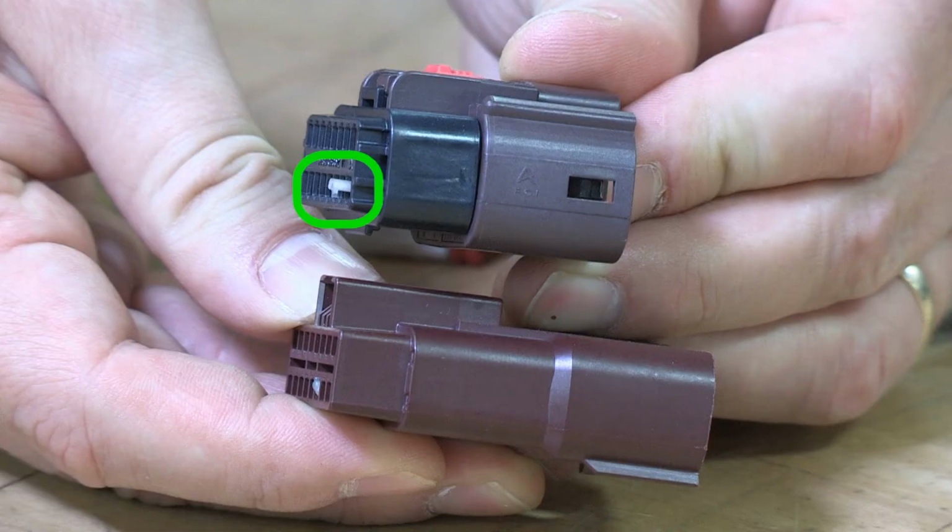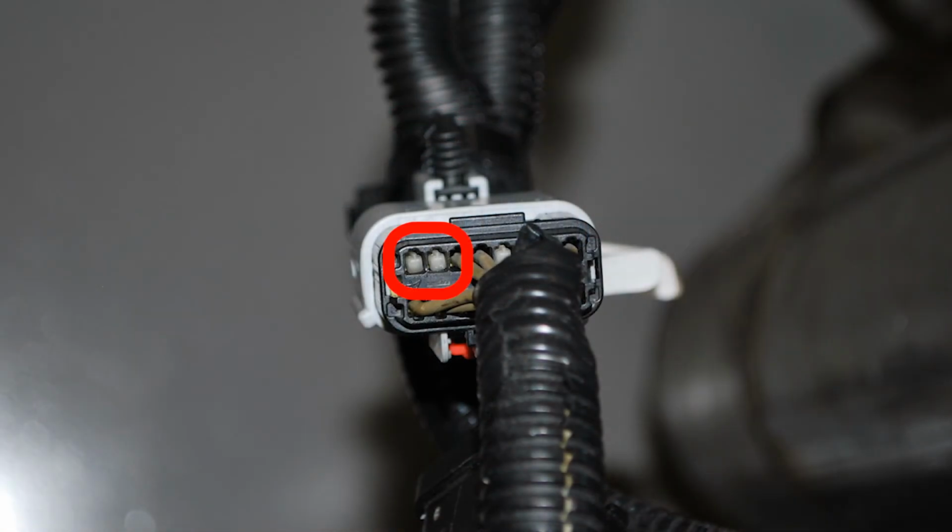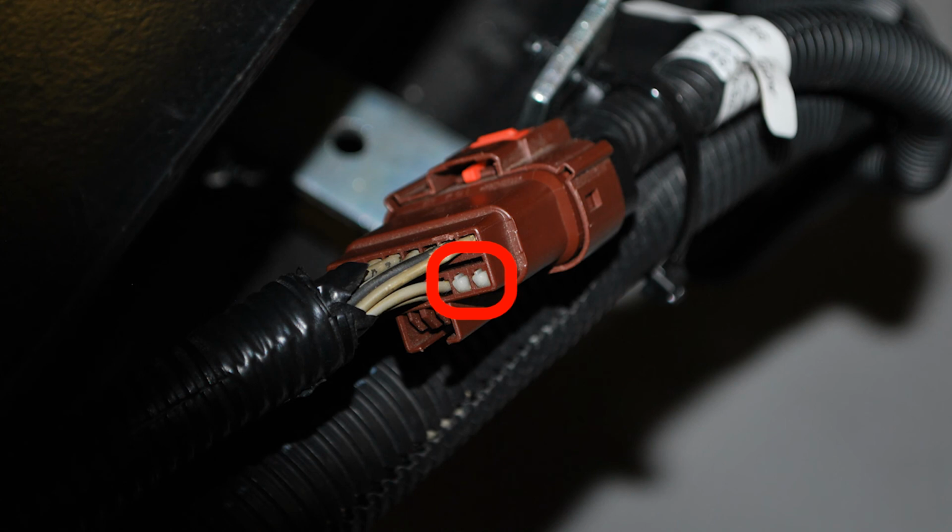The shorter housing will lock the cavity plug in with a small amount of the plug still protruding, but can then be inserted further to be flush with the connector housing. Cavity plugs with the hook feature facing outboard or with the tail protruding from the back of the connector have been installed incorrectly and can result in ingress and corrosion issues.